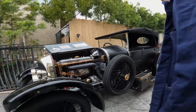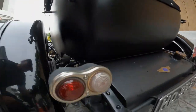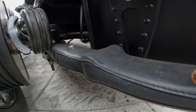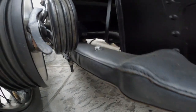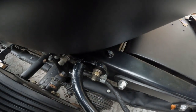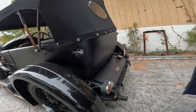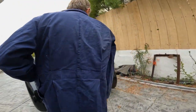This is interesting — the leaf springs in the back. Why would they have a sleeve like this on the leaf? Well, they're called gators. What they do is they're wrapped and filled with grease. Some of them even have a grease fitting right here — an Alemite — and you pump them full of grease. That just keeps all the dirt out, because back then it was all dirt roads.